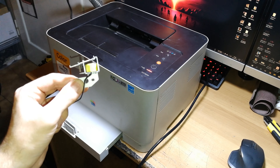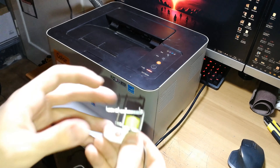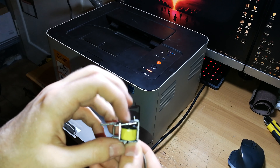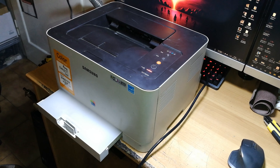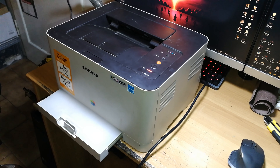The problem is not the pick-up roller — the problem is this solenoid. I discussed this in another video on my channel where I show what the problem is with these solenoids. As an intro: when the solenoid arm goes down it stays down, and when it goes up it's a bit sticky. These pads are the main problem, and without them the solenoid cannot work. I bought a replacement for around 4 euros 30 cents — about $4.50 USD — on AliExpress.